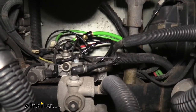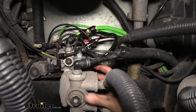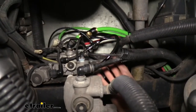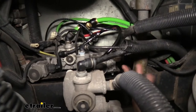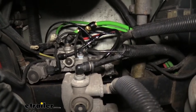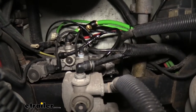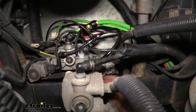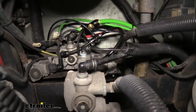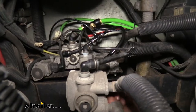You want to find your metered air first. I found ours quickly right here going into this brake manifold, which connects into the next manifold up top. Unhook that fitting and then push the air brakes — that's a great way to determine if you have the right line, as it should take the pressure out. You'll want to bleed that down anyway because you're tying into the air lines and you don't want them under pressure. If air is coming out of the line you unplugged, that's a good sign you've found your metered air.